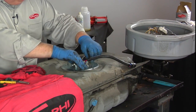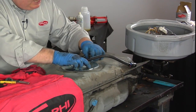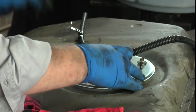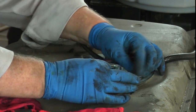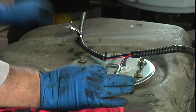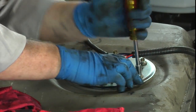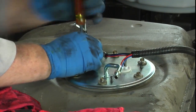So let's start these screws in. A little bit of a wrist twist with the ratchet just to cinch it up, because we're going to compress that rubber a little bit. We don't want to ruin it. So we'll do it in a crisscross pattern. When in doubt, always do common sense torquing and crisscross patterns so that you don't create any undue warpage of something flat, making sure our arrows are still lined up and it feels nice and seated, because there are little divots in that rubber seal that allow us to put it in position.